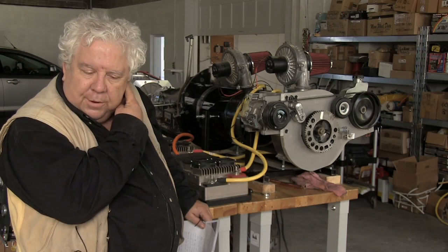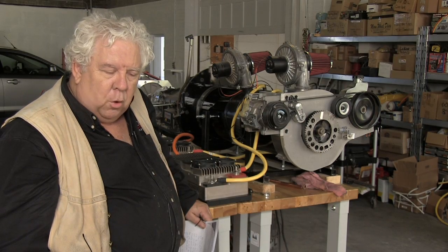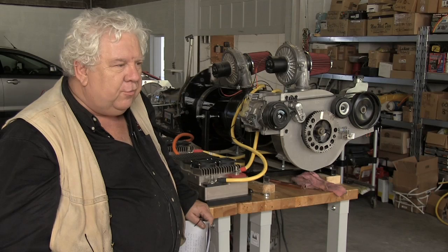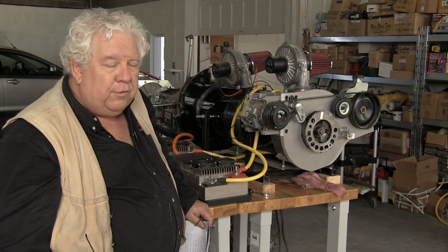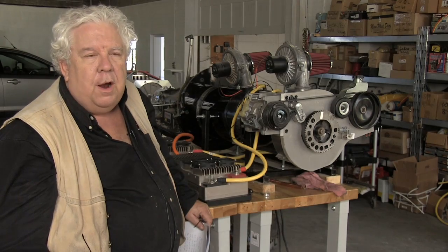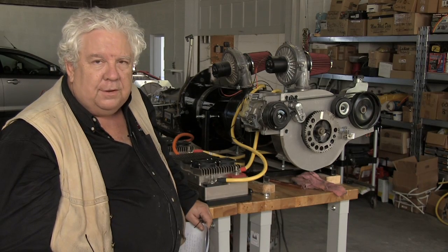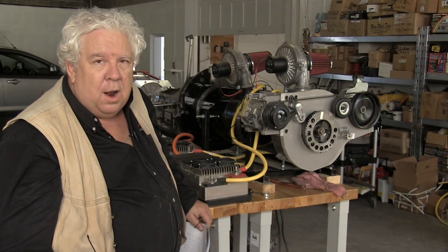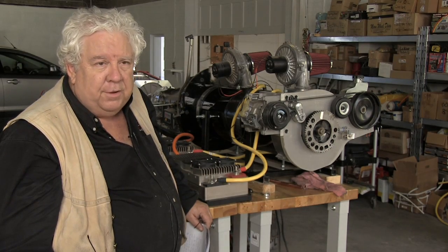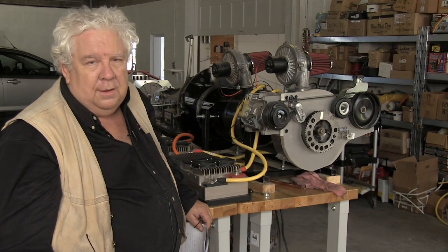We think that there's some advantage in the hydraulically connected automatic transmission using a torque converter. Torque converters have various uses in the ICE world, but we think they may provide an almost ideal buffer for this time difference in reducing shocks along a drivetrain when dealing with a large-scale system. And so we've eschewed the more popular concepts of in-wheel drive motors or direct drive units, which give up a lot of leverage. You have to have a big motor to move a 5,800-pound vehicle with a direct drive. With a 6-speed transmission, we can have a much smaller system to do that.